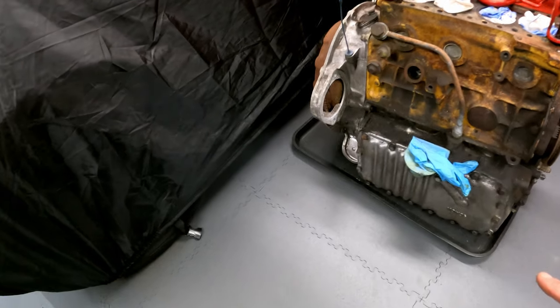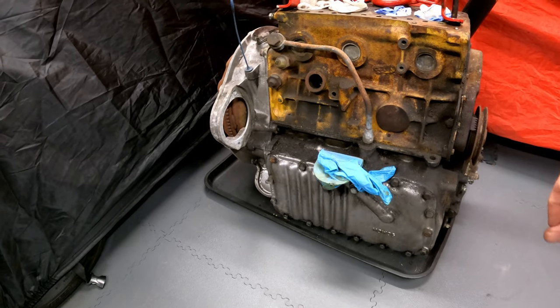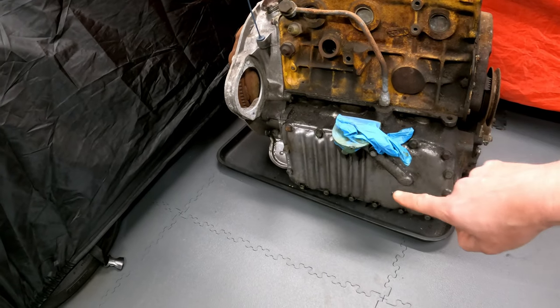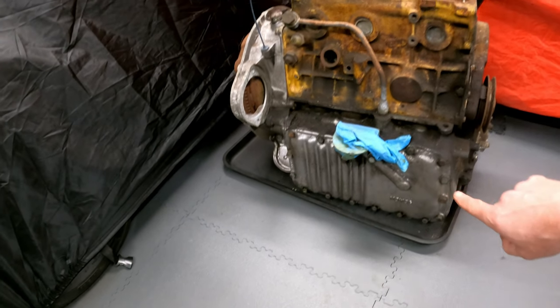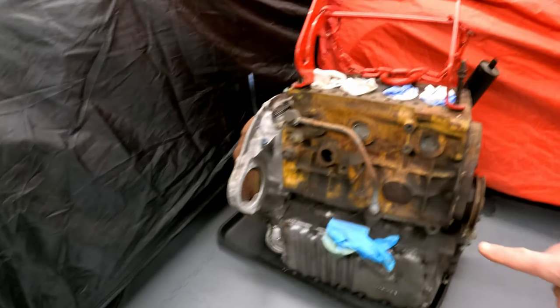So if anyone knows these AP gearboxes, I believe this is an AP2. It doesn't have park on it. Some of the later ones had park. So I'm going to be removing this front cover. I think it's quite straightforward. There's an O-ring in there, which I believe goes around there. Apart from that, it should be just a gasket. Please shout in the description if I'm going to do something wrong though before I do.